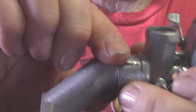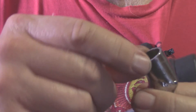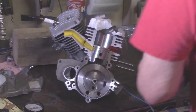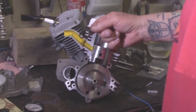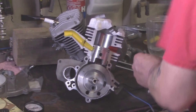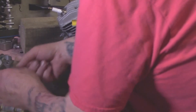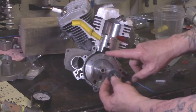With the tubing-style intake, I'll take a file and file off any burrs left from manufacturing that they don't clean off — that's a very common cause of too much air entering the engine. Another cause might be the intake gasket — either it's missing, not installed correctly, or damaged — or the intake is simply not bolted in tight enough. Other key areas for maintaining that 16-to-1 ratio are your cylinder base gasket and your crankcase gasket, along with your crankshaft seal.